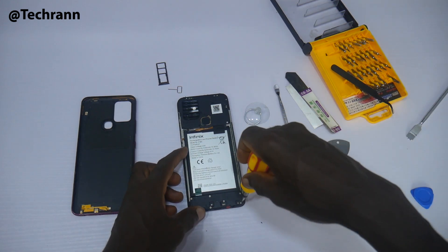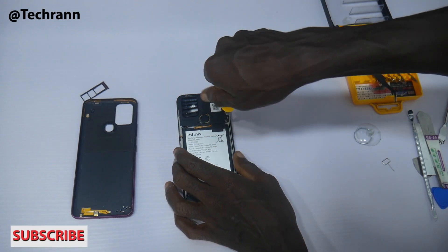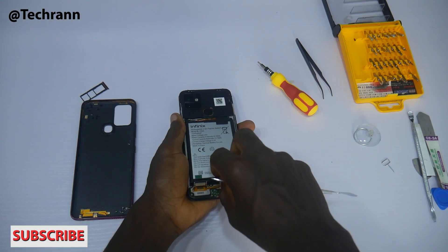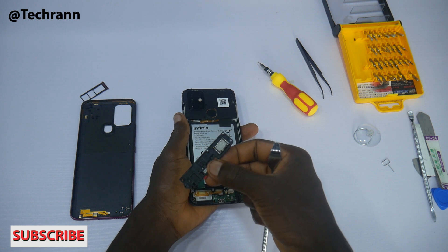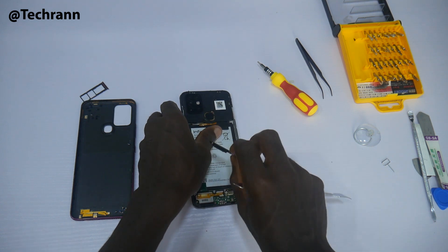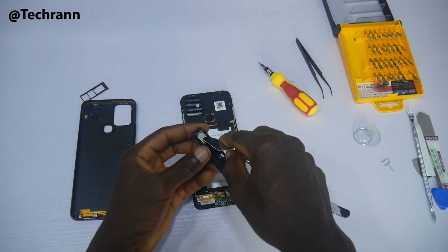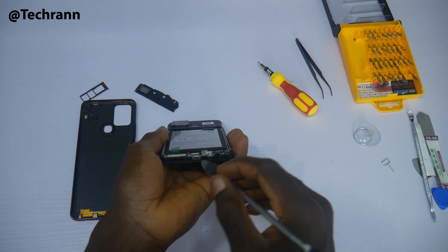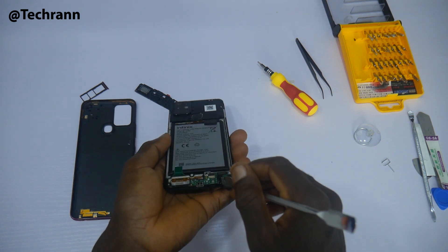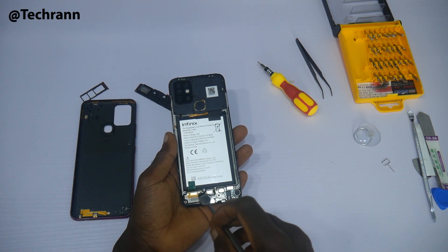It's time to get inside the phone. Holding the phone together are some screws. After removing the screws, the plastic coverings can come off. The speaker is situated at the bottom, embedded inside the plastic covering — since I'm not destroying the phone, I won't be taking it out. Other things at the bottom include the USB charging port, headphone jack, and a small motherboard that connects all the way to the main motherboard at the top.